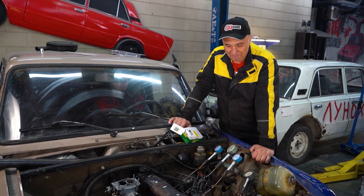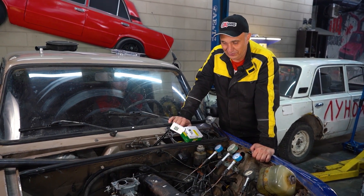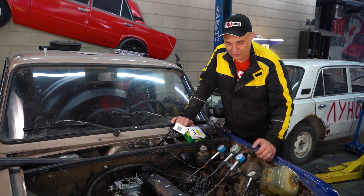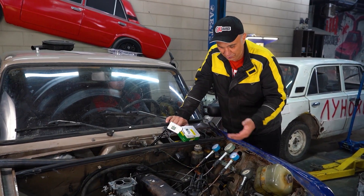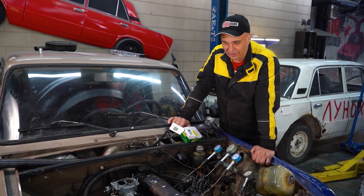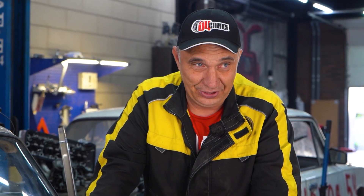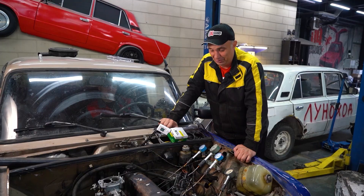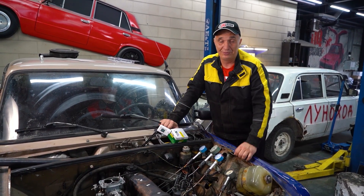The gauges weren't fooling us — the pressure would indeed be around 30 to 60 kilos. As for this engine, the compression did differ from one cylinder to another, but the internal pressure was pretty much the same across the board at about 30 kilos. The figures from the internet were between 30 and 60 — we did see 30 but couldn't get up to 60. This was a really interesting experiment. We measured the pressure, albeit only during startup and at idle, but that's still something. Watch us, subscribe, send in your suggestions, comment — catch you guys later.